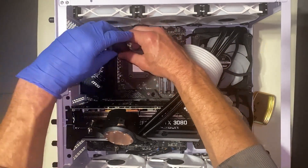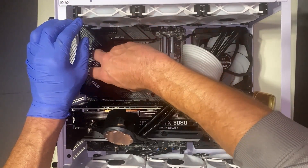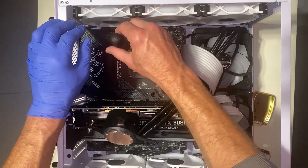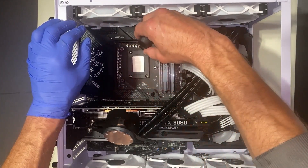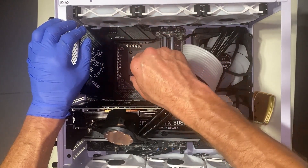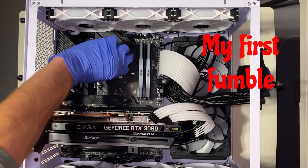You're just going tight with these — you're not going to torque these screws at all. I personally like the brackets better because the threads go all the way into the motherboard, whereas with the washer mod they don't go completely in. I will be doing a future video that compares different brackets to the washer mod.